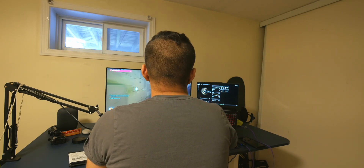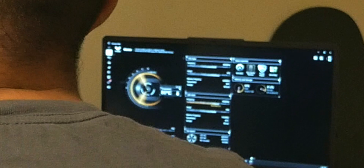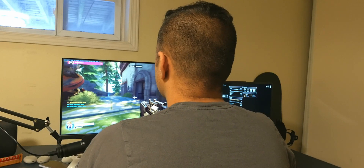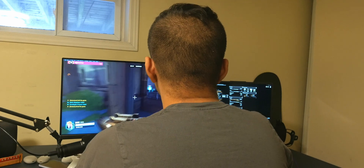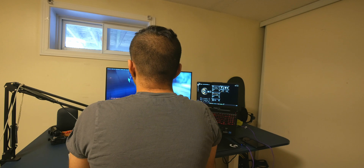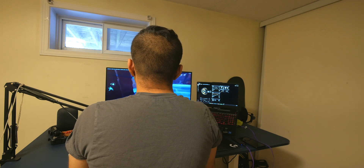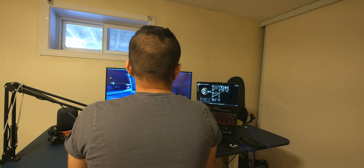Not so bad so far — I'm getting about 370 FPS average, up to 400 if I'm just standing around. But the CPU is already reaching 87 degrees, which is too close for comfort. The GPU is not heating up as badly. For the sake of testing I'm going to play a full match of Overwatch to recreate a real-life situation, and that will tell us what temperatures the laptop reaches after one full match. I'm already seeing a lot of FPS fluctuation because the CPU temperature is bouncing up and down.